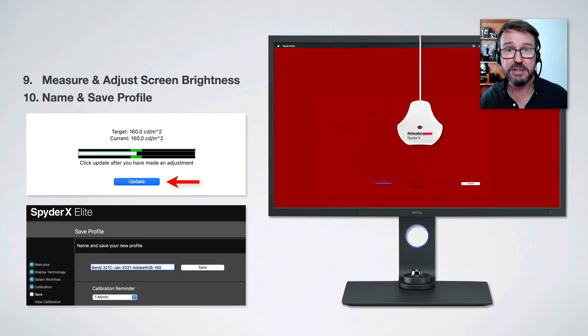You then proceed and a whole series of colors will be shown to the monitor calibration device — this is where the profiling comes in, where color accuracy is put into the profile. If your monitor displays red slightly magenta or orange slightly red, those will be adjusted on the fly by your Adobe software. Your monitor won't have any unique characteristics anymore — it'll basically be adjusted so it is an accurate display of color.